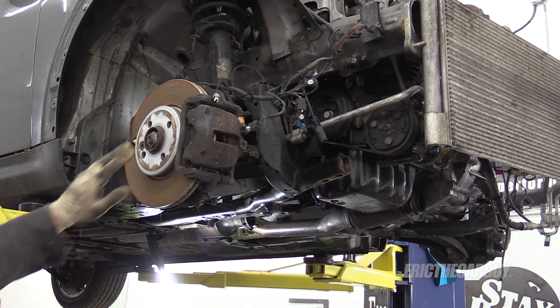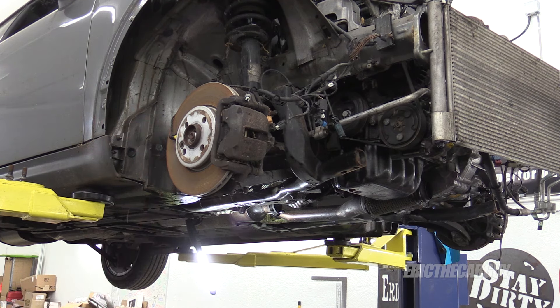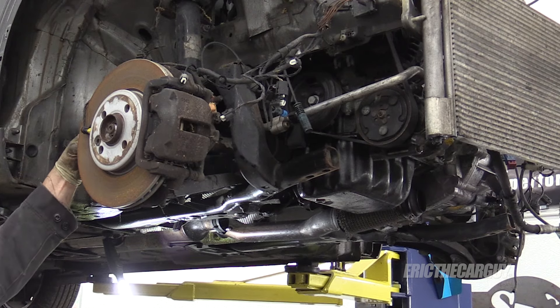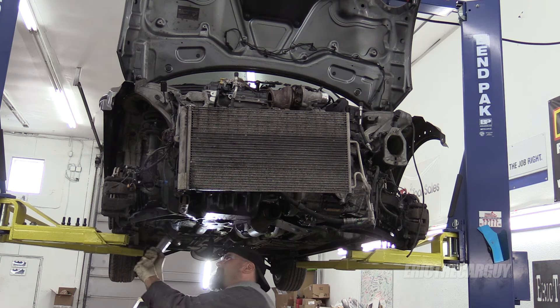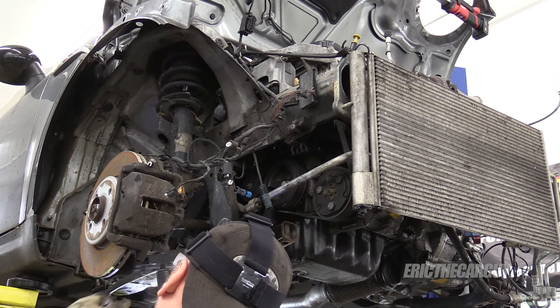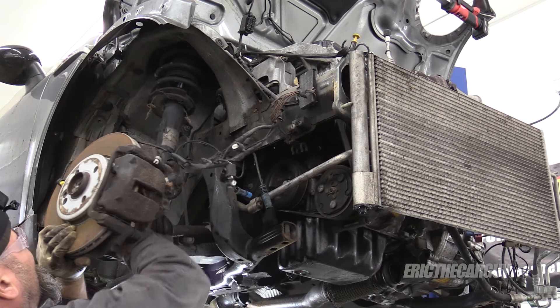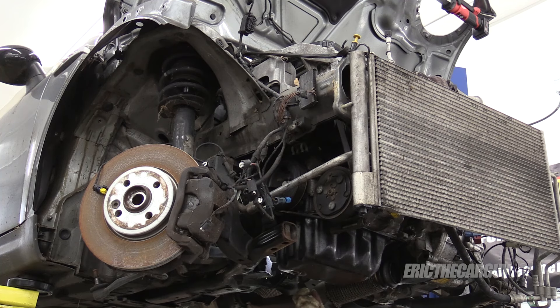A lot of movement now. Axle nuts, 32 millimeter. I'm using a 20 millimeter on these but it feels loose. I'm going to do the tie rod end first. That'll be 18. Let's take care of the intermediate shaft part. With this mount out of the way it's easier to get to. Yes, there are 13s. Very glad I took that mount out because I'd never have a swing on the ratchet otherwise. This lower one seems like a perfect job for this.